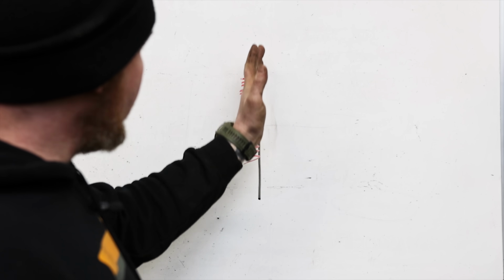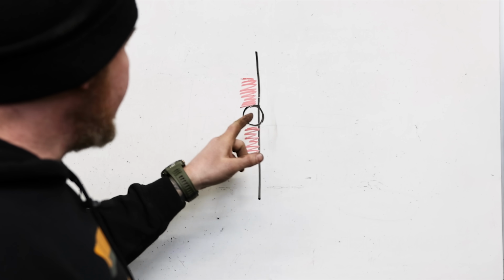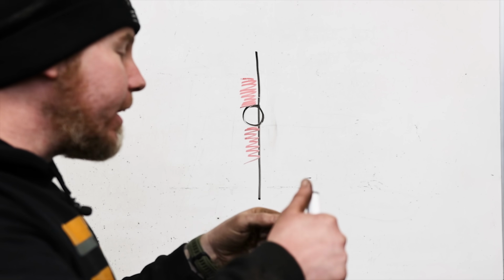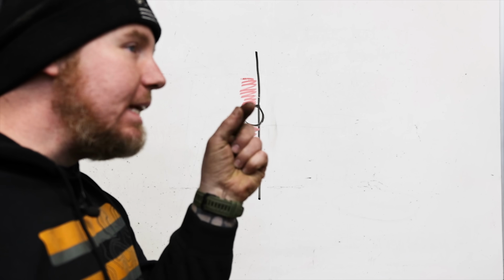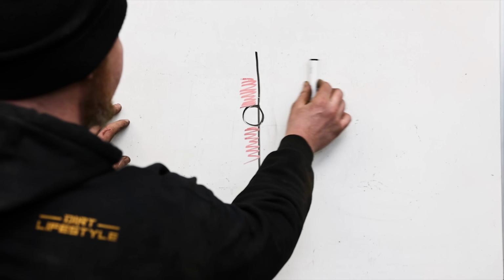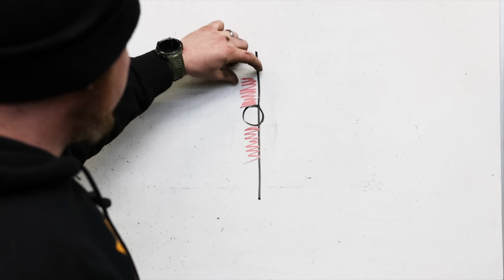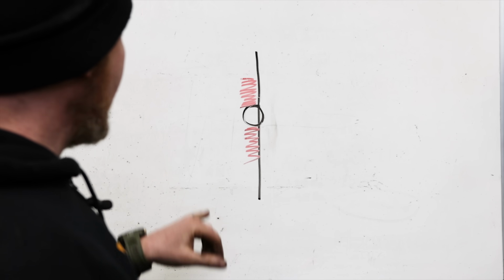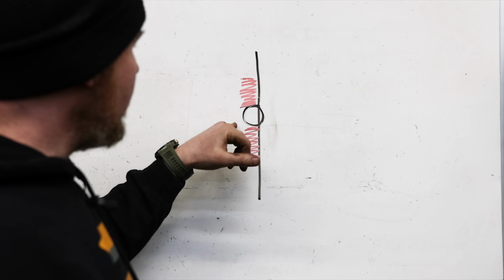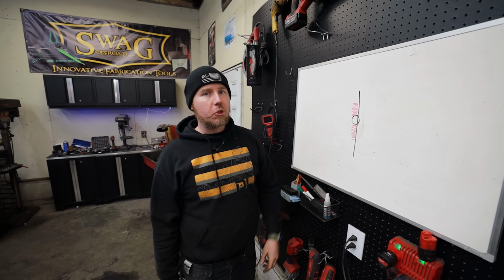I think what happened is the vertical part of the truss went right over that vent hole that was right there. With a mirror, I could just barely see a tiny circle on the inside of that truss. So this would be the inside that we welded. We stuck our nozzle through and welded the inside, and this is what I welded whenever I first did the truss. What I'm surprised about is that normally I would plug weld any holes and grind them smooth while I'm prepping for the truss.